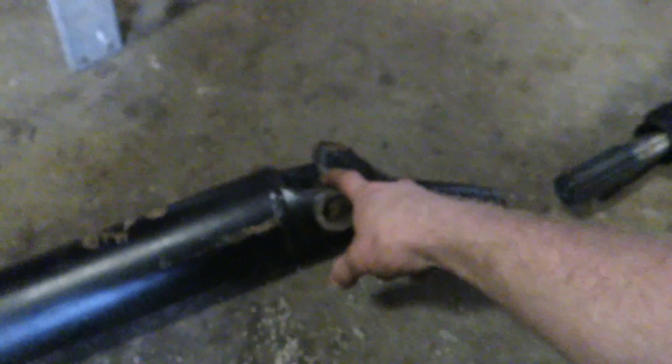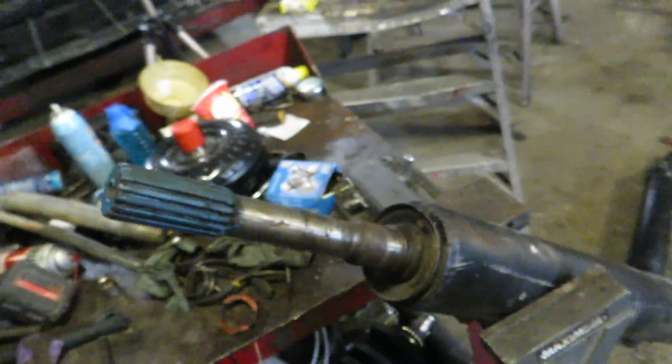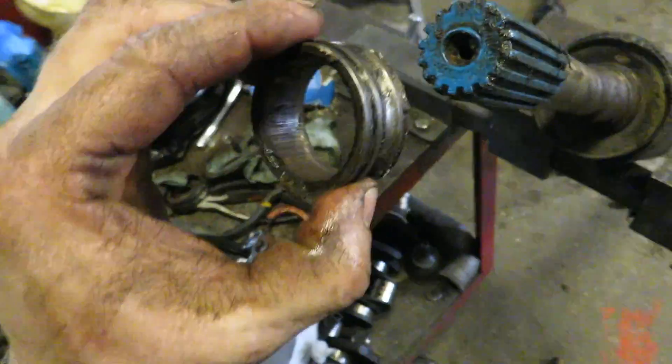We're gonna knock some new U-joints in there — we have a video on replacing U-joints already, so check that out. Some of these, when you pull them apart, have a collar on here that locks on and keeps it from sliding off. This first gen it just slides off and has a master spline. We'll knock this hanger bearing off — there's nothing that holds that on, it's just a press fit. I told the customer I would do this job, but he supplied the part and it doesn't fit. There's the old one — it won't fit over the splines. Wrong one. Why can't it be easy?